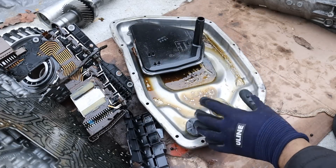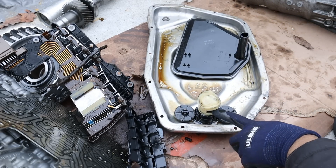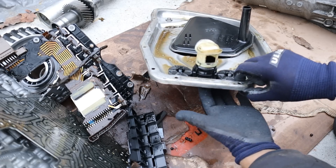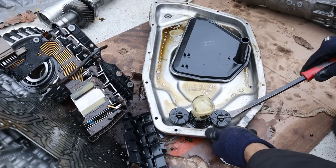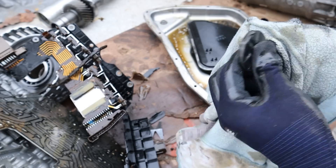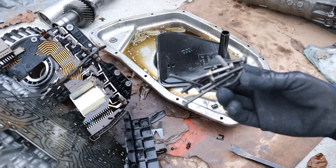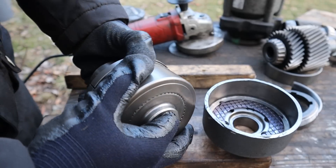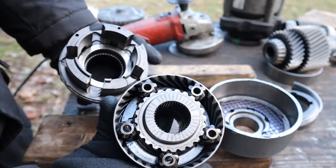Here's a look inside the transmission pan. You do have a standard drain plug back there, but you also have this plastic contraption which is used to set the fluid level. Once the fluid rises above this little ledge, it pours down out to the overflow hole. That's how you service these transmissions nowadays — there's no dipstick tube or fill port. They also have two magnets which had a bit of paste on them. As the transmission wears down there are going to be a lot of particles, and you want those caught by the magnets and filter rather than recycled. That pretty much sums up the transmission part. That's a look at how this version of Audi's Quattro all-wheel drive system works — make sure you subscribe if you want to see more videos just like this one.